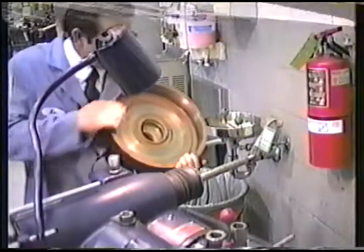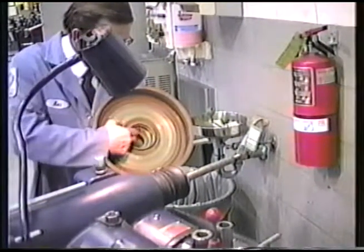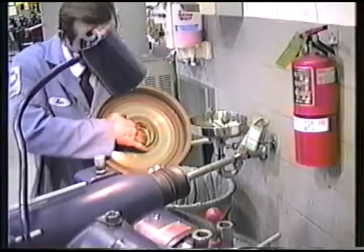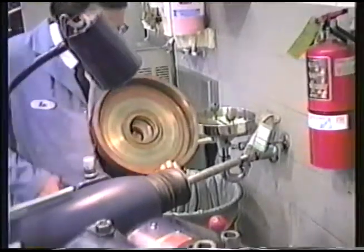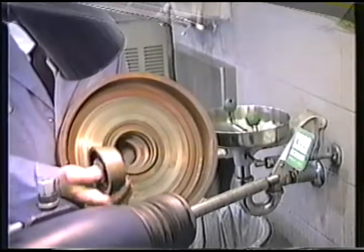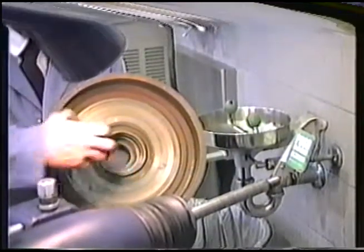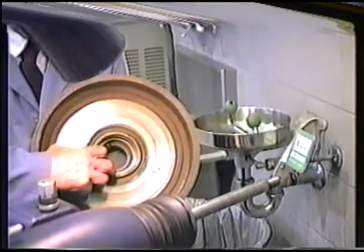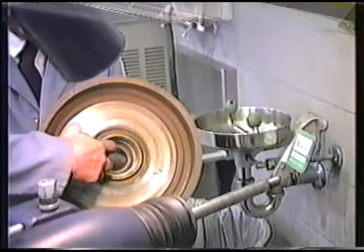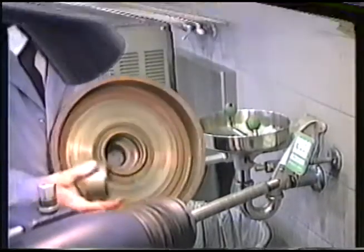Now we're going to machine a larger drum, which should be quite a bit easier. Now this drum is missing the bearings and or bearing races. Therefore, we're going to use the standard centering cone and mount right on the very edge, which is machined, so it's a good mounting. The only thing we have to watch out for is for nicks and burrs and bumps. If there's any on there, they will have to be filed off.